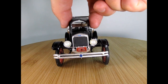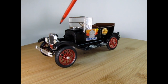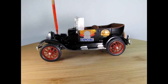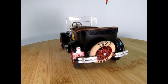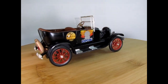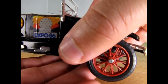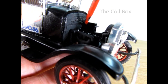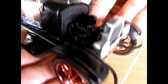Now I can lift the hood up here. Just as I rotate it around, you can see the Model T engine in here. This has got the buzz box, which is actually the coil up on the top — a very nice, simple model. So I can bring this up into the camera here to show you some more close-ups. Here we've got the exhaust side of the Model T engine, and you can see the updraft carburetor sitting down in here. Then this box would have wires going to each of the points — your magneto and all that jazz is inside there.